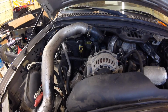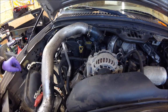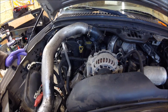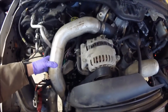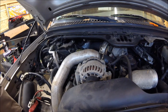Alright, so putting stuff back on. I'm gonna go ahead and put this duct on. I guess, I don't even know what it's for. Looks like an additional intake into the side of the turbo. The bottom end goes right down here. There's one clamp down there, two clamps up there. I don't think that one's even loose. This clamp is an 11, these band clamps are 11 millimeter.